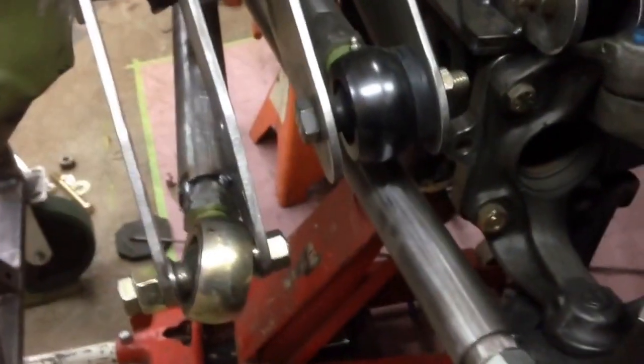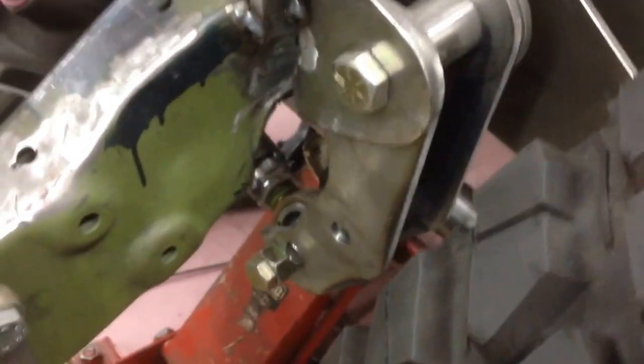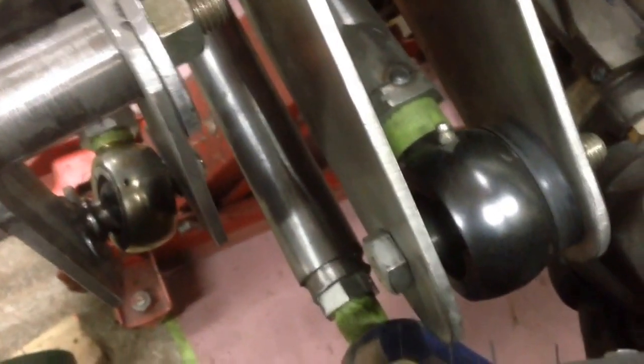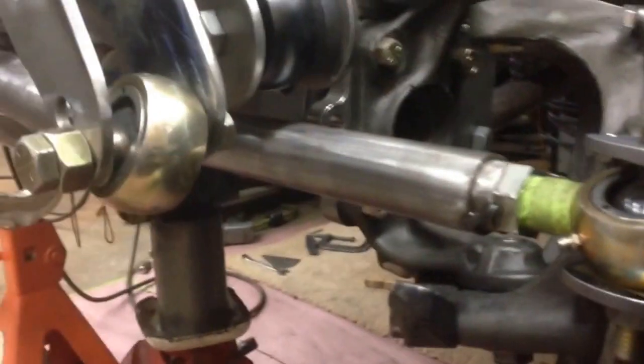Here's the clearance of the bars coming across. Here's how crazy stuff's getting on this side — I'll try to swing the wheel over to show you. Watch that tie rod, how it swings underneath the Panhard mount as it comes across because of the Ackermann in front of it. That swings around, and now it's completely underneath it. That's crazy business.